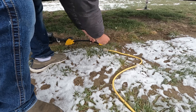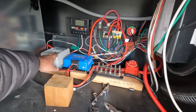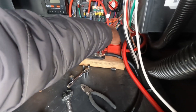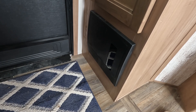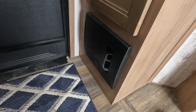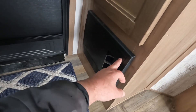We're going to shut down the shore power. I'm going to shut down battery power. We have solar, so I already killed the power for our panels. On a 2023 Wolfpack toy hauler, model 345 Pack 14.5, the charger converter is behind the distribution panel.